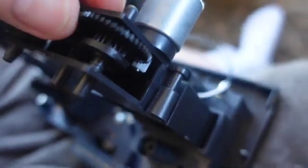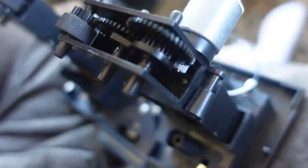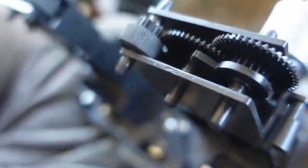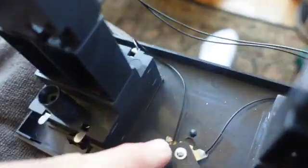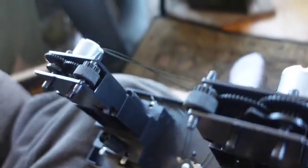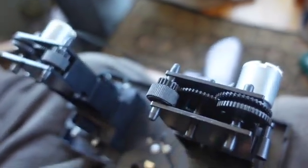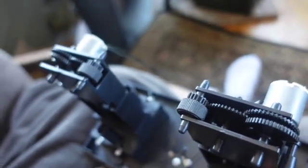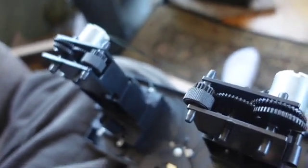So I want to do this with both hands. I don't want to get too much, but I can get down in there and you can see the little spindles. Be very careful of this thing or you're going to have a very mad customer. It looks like there's already some corrosion down there. Probably happened on the way over on the boat. So I'm going to get down here and oil these things. Let's listen to it one more time. It's not terrible, but it could be better, and it's just service. Not hard. It wouldn't take an hour, or less than an hour.